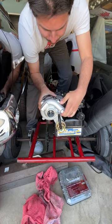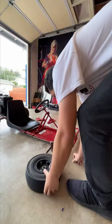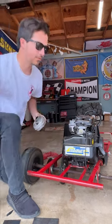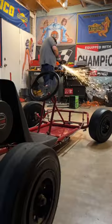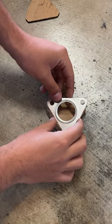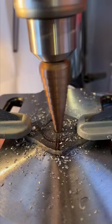Today I'm mounting the turbo to my go-kart and I know a lot of you are excited about this. The first thing I had to do is replace the wheel bearings because I broke the last ones driving the cart around — easy fix. Now I'm starting to build the piping so that the engine exhaust can spin the turbine in the turbo. I'm in no way shape or form a metal fabricator, but I bought thick steel to make the exhaust flanges. I cut out little cardboard templates of the exhaust hole on the block, marked them, and then used a jigsaw and some other tools to cut it up.